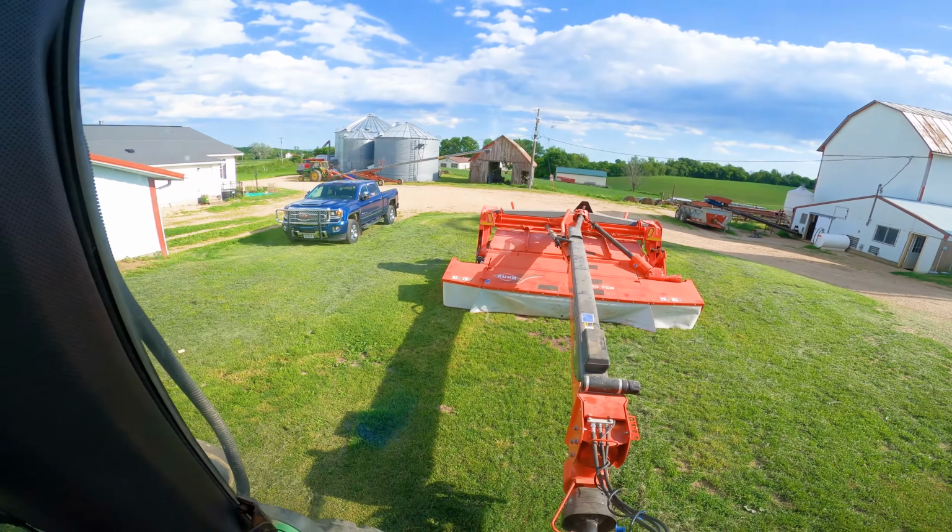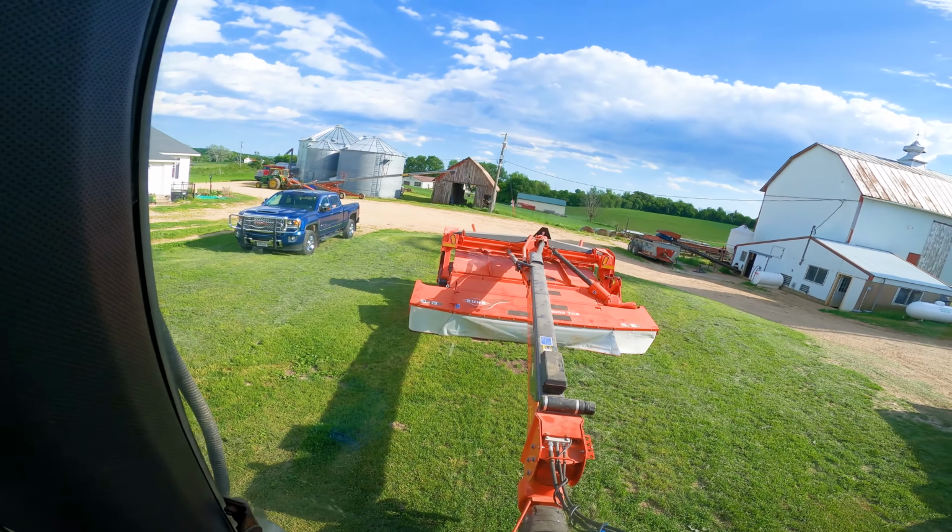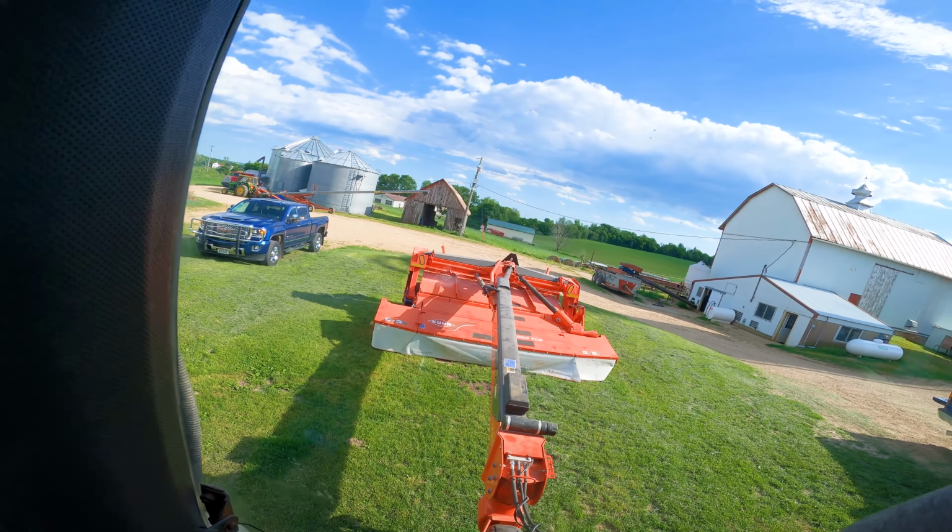It's already had the first time set up and everything done on it, but I just want to kind of take things slow. So Travis and I just adjusted the torsion bars in the back. We noticed that one was about an inch more off of the other, so we straightened those out and it should be running level now, but we're gonna lift it up, take it out to my place and see how she does.